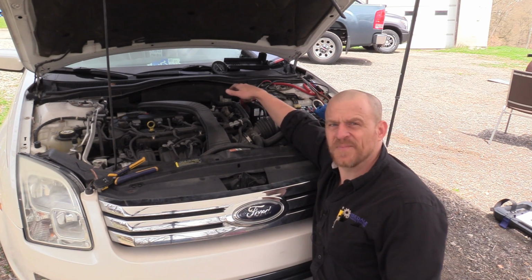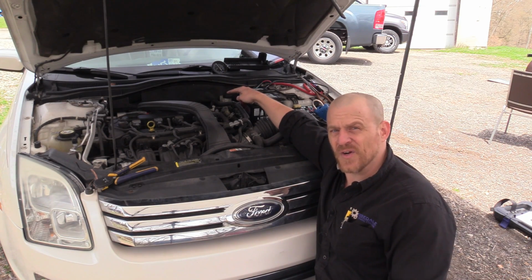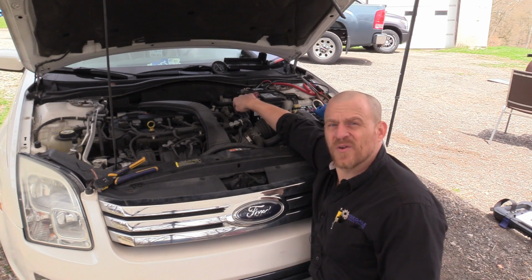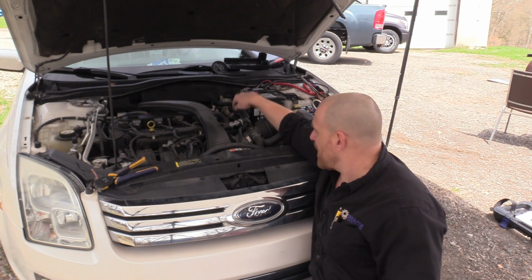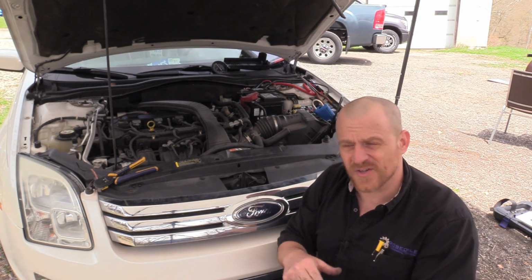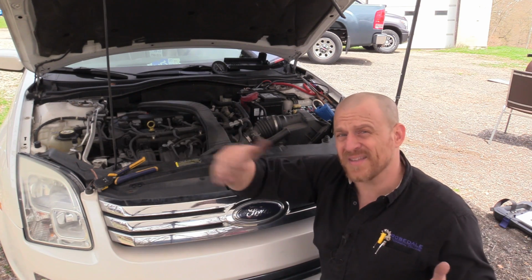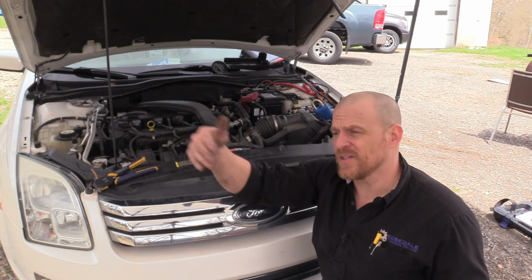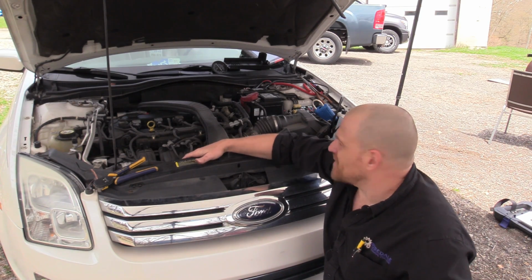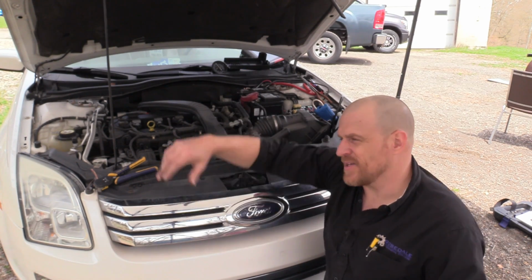Fortunately for us, because of the way things went, we had a vacuum gauge on the diverter telling us that the vacuum switching solenoid or valve works and applies vacuum to the diverter. It also told us the computer driver was good. It also told us the computer driver control wire, the integrity of the wiring from computer to solenoid, was good. Same thing with the relay. So pretty sweet that we have the vacuum gauge there, that you guys could see that.